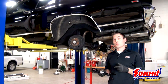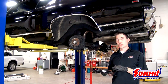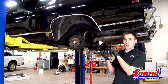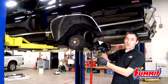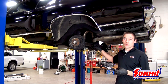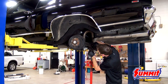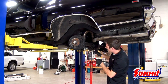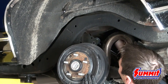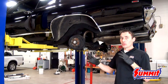Continuing with the stage 2 kit installation on the Chevelle, we're focusing on the rear upper trailing arms. This is a tubular design — the stage two kit has a non-adjustable arm while stage three comes with an adjustable style. One key thing to note is where your Zerk fitting is placed for greasing. Don't face it upward in the vehicle or you'll never reach it — make sure it's facing down for easy maintenance access. We already installed the bushing into the differential housing. When sliding it up into the slot, you may need a screw jack to pitch the axle a bit and change the pinion angle. Only do one trailing arm at a time, as removing multiple at once gives the axle too much movement and makes realignment difficult.